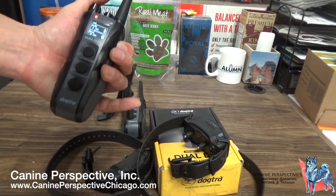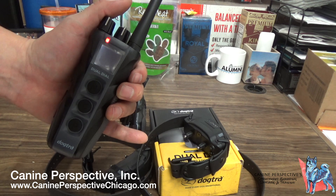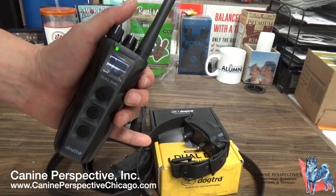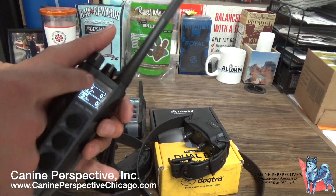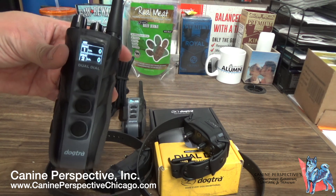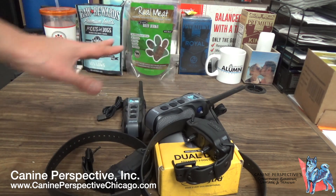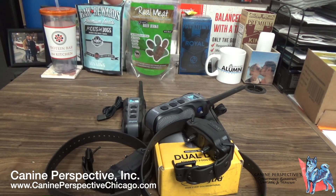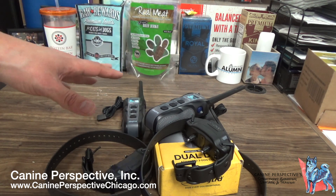Make sure you read your manual — it's in the box. When powering on, hold until you see that screen, then let go. When powering on the collar, hold until you see the green light, then remove your finger and let it power up the rest of the way. Don't hold it until it starts blinking. If you accidentally unpair it, you have to send the entire system back to Dogtra — they need everything in order to pair it as a family system. You cannot just send one unit.